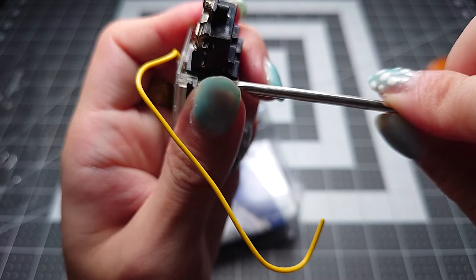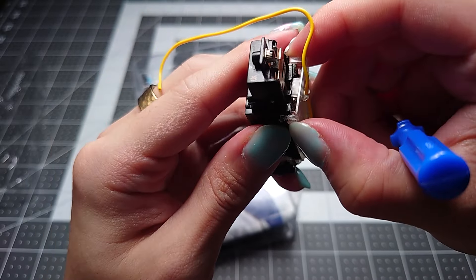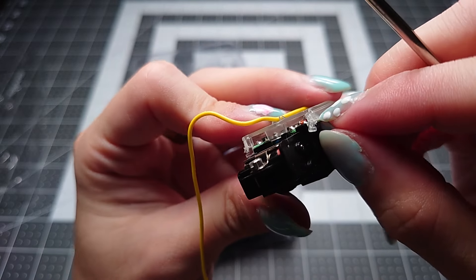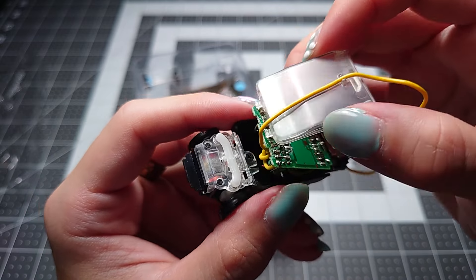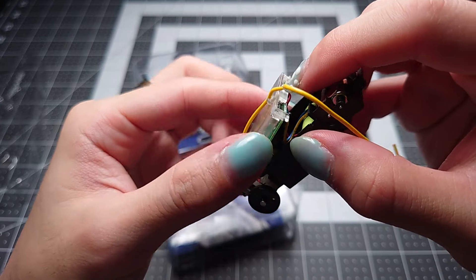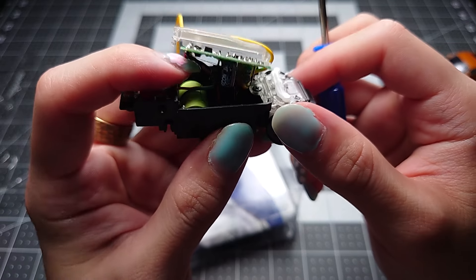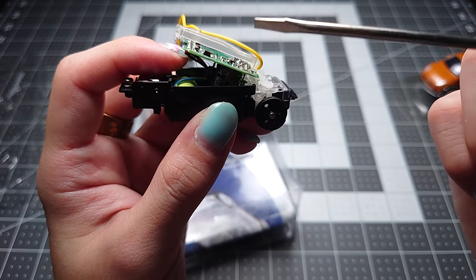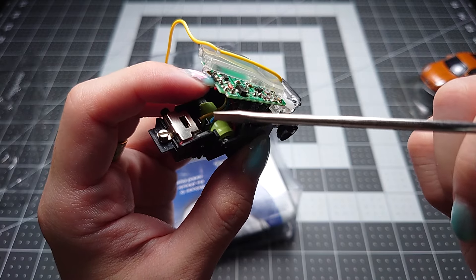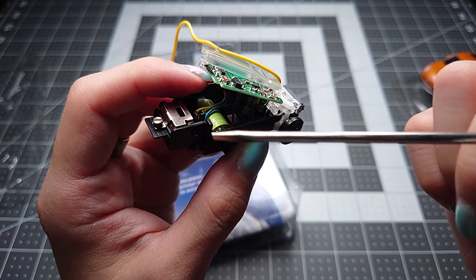After clearing off the adhesive, gently pry the cover off. You want to be as careful as you can not to break these tabs because there's basically nothing else holding the cover onto the chassis. Looks like the antenna wasn't even clipped in this time, so that's fine. We just need to lift the board very carefully up and out of the way. There's a very fine wire we don't want to damage. You also have these two wires for the motor that go on top of the battery, so you have to gently move things around until you have a clear path for the battery to come out.